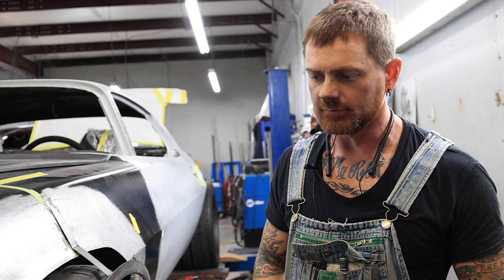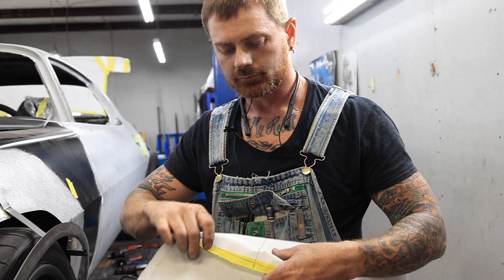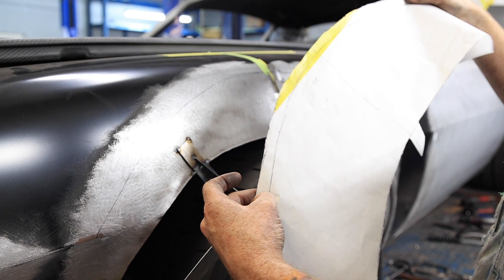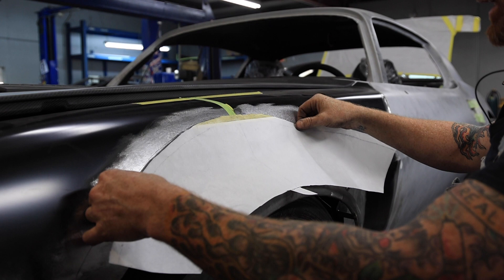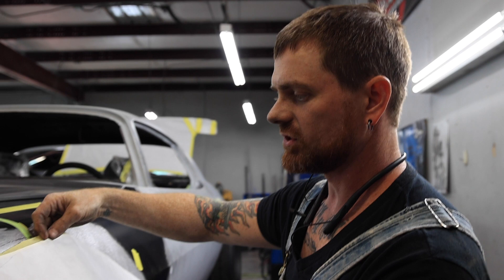I made a template of the first flare piece — this is the driver's side — and I always mark the centerline, then flip it over for the other side. We use paint masking paper for the template. You can see I have a border here where I tip the edge so it lays flat on the fender, and later we cut it in for a butt weld into the fender itself. We have centerline marked so we're roughly in the correct spot. There'll be a stretched portion in the center done with the English wheel.